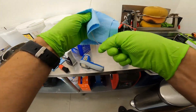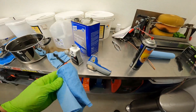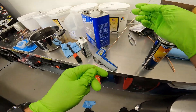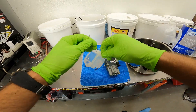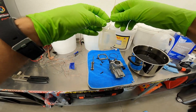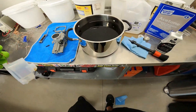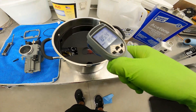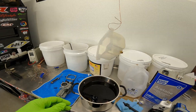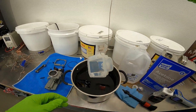Now I'm going to attach a copper wire to it — I've been doing a lot of zinc plating and black bolt dipping, as you can tell by looking at the bike. I've got a nice clean wire, going to stick it through one of these bolt holes and hook it up so it can't come off. Then we submerge it — temperature is at about 85 degrees. Take one good hard last look at it and let's see what happens.